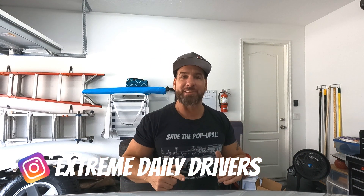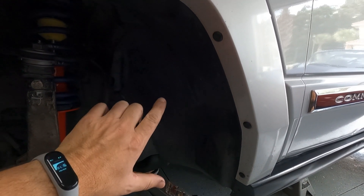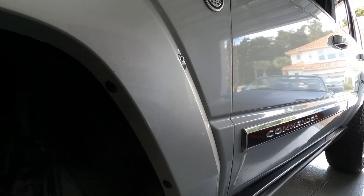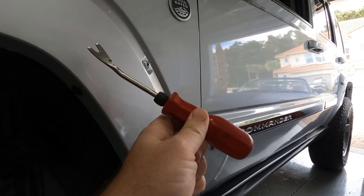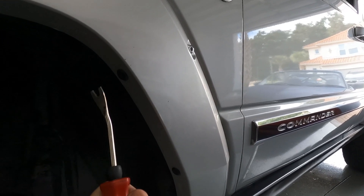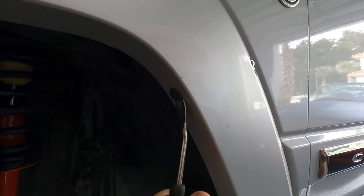Let me grab some tools, pull this plastic liner off, and we'll get to cutting. In order to get behind this we have to go ahead and remove the front of the liner. The way you do that is you've got these Chrysler rivets — you can pull them out. I use this interior pry tool; if you're a fan of the channel you know I use this tool for everything. I'll put a link down in the description — if you don't have one of these, you've got to get it. Basically all I'm doing is getting it underneath here and prying it off.